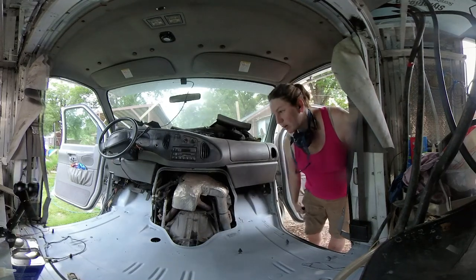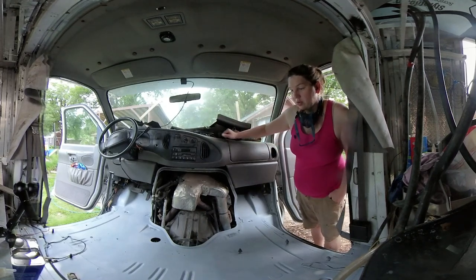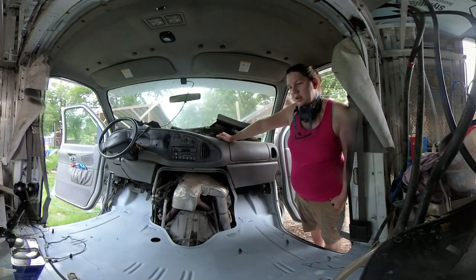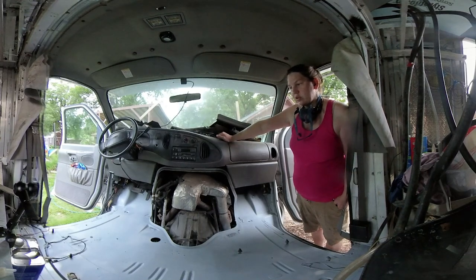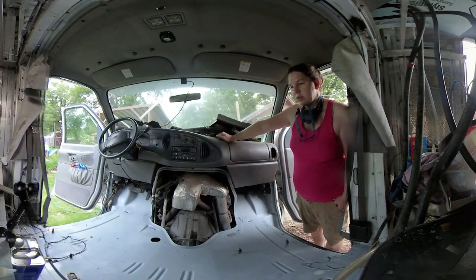Well, we lost power on the camera and the charger quit working today. I don't know if it's the battery or the camera or just whatever. It's over a year and a half old, so you wouldn't think it'd go out, but it might. Anyhow, I went ahead and got it cleaned up in here, de-rusted and primed with the actual self-etching primer. I'm just going to leave the primer on it. It should keep it safe for a long time. The floor looks good. There's only one spot with a little bit of concerning rust, but it's not enough to really do anything with. So I'm hoping the primer will keep everything safe. And we're going to lay the foam in here first, and then lay the other stuff on top of it, get it trimmed to size, and go back together. Hopefully, before that storm shows up.